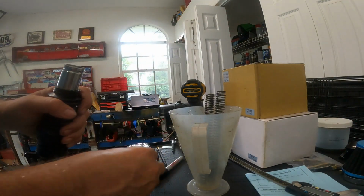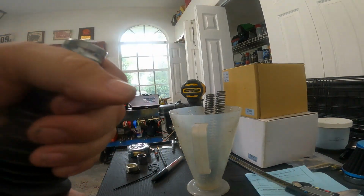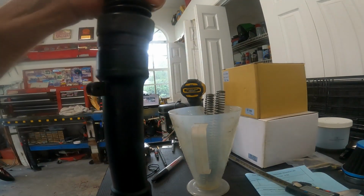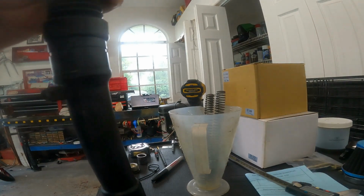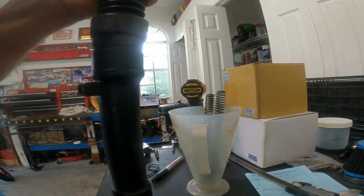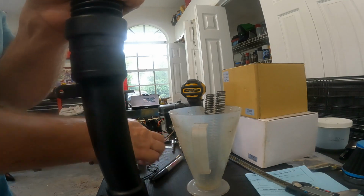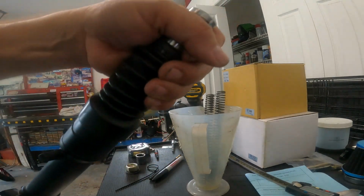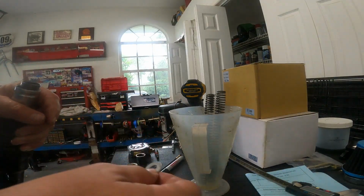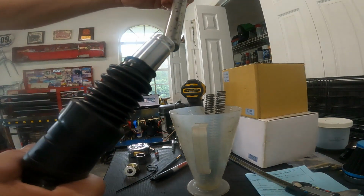And you're probably asking, why do the Gen 5 forks work so terrible? Well, Icebear Maddog, whatever, Icebear, they're a US supplier for Chinese products, obviously. And you probably got feedback from the customers. They wanted 14-inch wheels on it. And to put the 14-inch wheels on it, they had to limit the travel. And they just limited the travel on a standard fork. And how'd they limit the travel? They put this huge spacer tube in there.